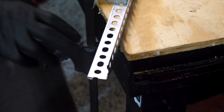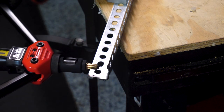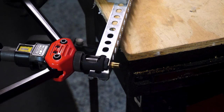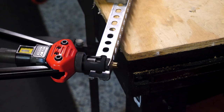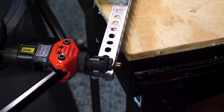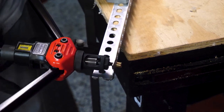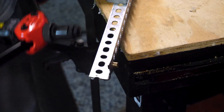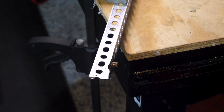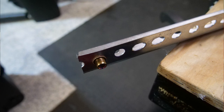Let's demonstrate this on a little piece of steel. I have a random piece of bent steel with pre-drilled holes, nice and easy. You want to slide the Rivnut in and then just compress it. Once it's in and crushed, you just spin this out to get your mandrel stem out. And there you go — it's installed. Now you have yourself a nice threaded hole inside of this steel.